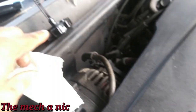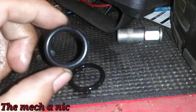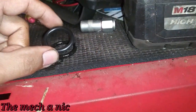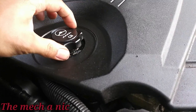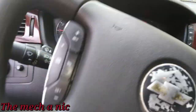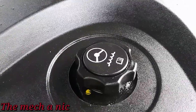I'm going to see if I have an O-ring that fits this and see if it fixes the issue. My little kit does seem to have a replacement that matches up. Put them side by side — same exact diameter, but the new O-ring is a little bit thicker, so it might seal better. It was definitely a tighter fit with the new O-ring, but I got it to go on. I even had to massage that little bit of deformed plastic back into place. The cap's on and locked. I started the engine — I had it running just as long as when we saw that power steering fluid coming out — and it's not doing it anymore.